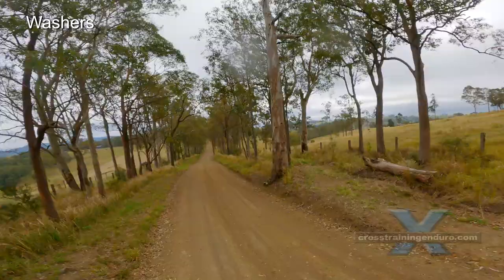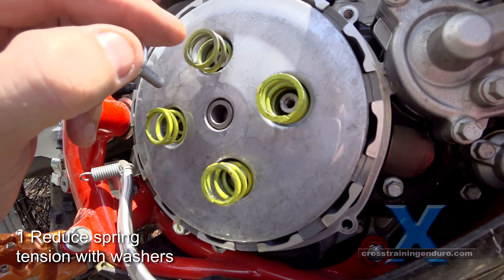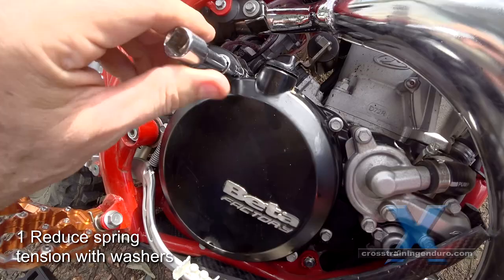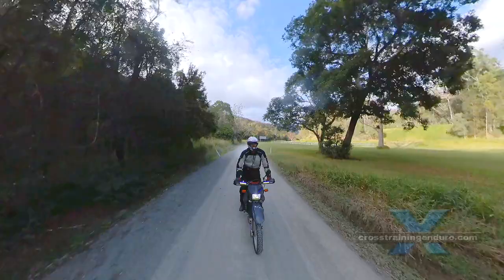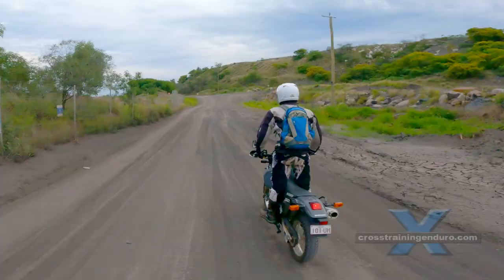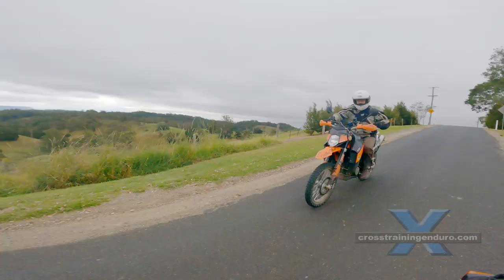Next, spend $1 on a pile of washers to reduce the tension of your clutch springs. Use washers so your clutch bolts sit further out — the washers need to be small enough to fit inside your clutch springs. Use combinations to get the desired width. The problem: if you use too many washers, the bolts will hit the inside of your clutch cover. I used two millimeter wide washers without problems on my Beta cross trainer. The clutch felt about 15% lighter. Search the forums to see if other riders have tried this mod on your type of bike.